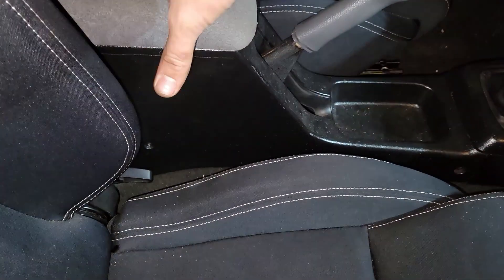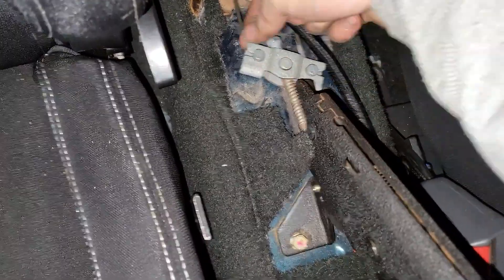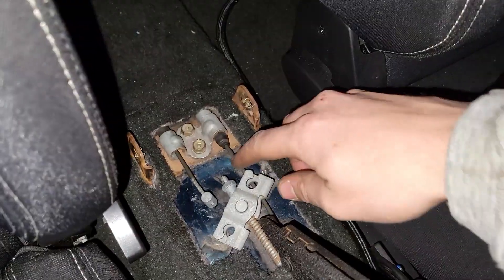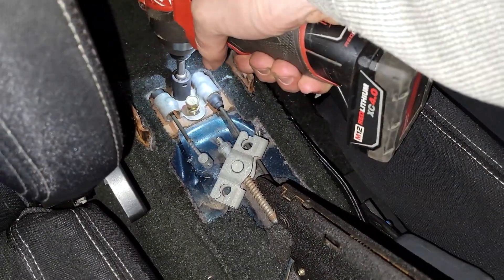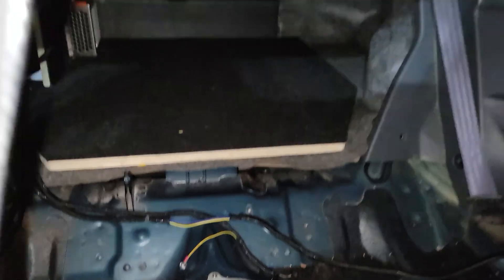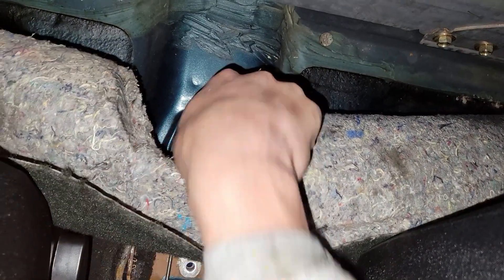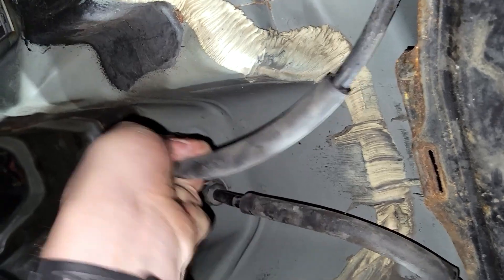Now we'll go inside the car and remove the cable from the handbrake assembly. I already have my center console unbolted so I just pull that right out. Here are all the e-brake cables attached — they're pretty easy to slide out, just like that. I'll go ahead and do both of them. Then we'll remove this bracket. I've got videos on how to pull apart the interior of this car, link in the description. Basically you want to remove the back seat, pull the carpet forward, and you'll have access to where the cables go through the floor. I ended up just pulling them through the bottom — it's a little bit easier.